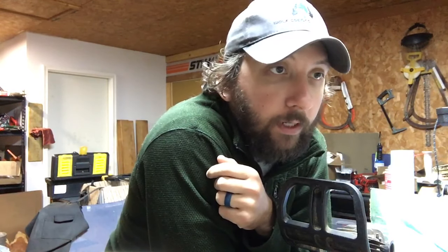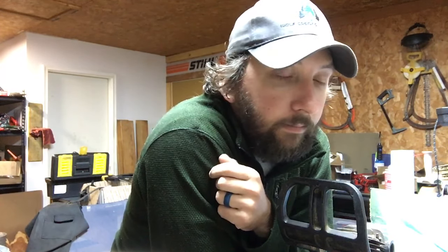But on this 026 here that we're building for the benefit saws, I got it with a bum guide bar stud. So what happened was both stud holes were stripped. They attempted a helicoil repair and was successful on one. The other repair pulled out, and if I had the stud I would show you, but it was cross-threaded in, and then I'm assuming it somehow got stuck and pulled out, whatever. But that makes things more difficult because a failed helicoil repair is really large, right?